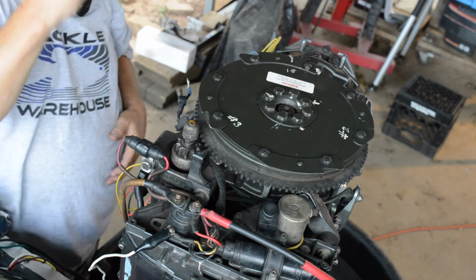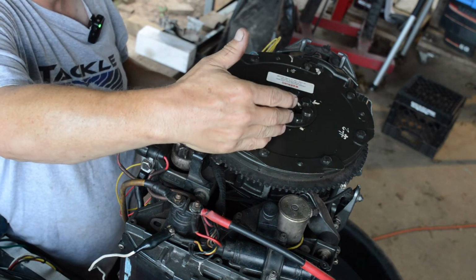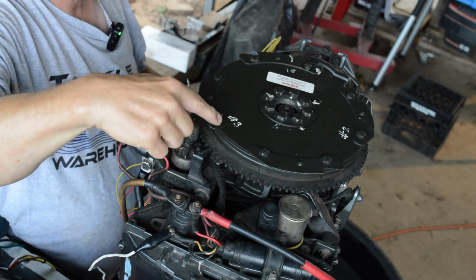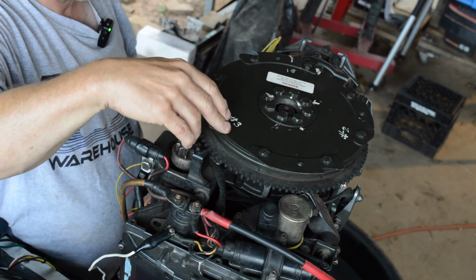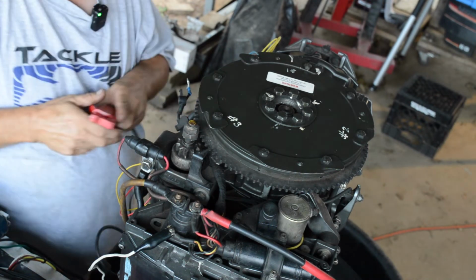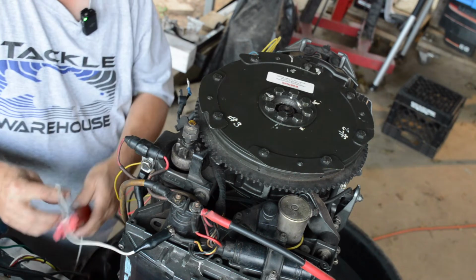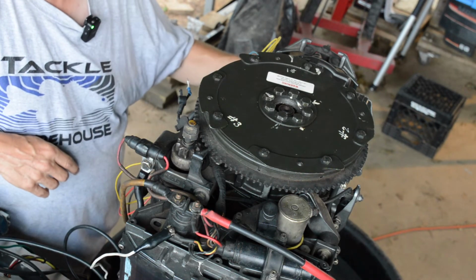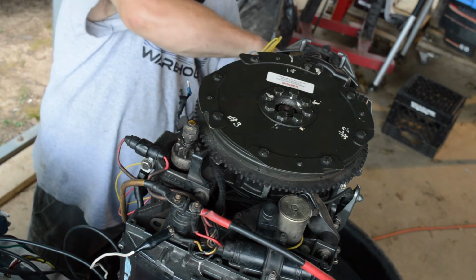So we went down each plug wire. Number 1 showing right here. Plug wire number 2, it's showing it's right here. Now, plug wire number 3 showing right here. So we're in line. Now, I guess we can put some spark plugs in it, hook up some fuel, and see if that runs. Something might take me a minute to do that.